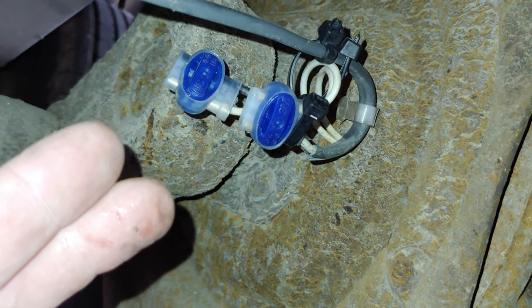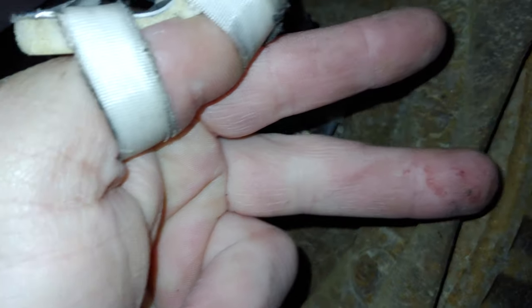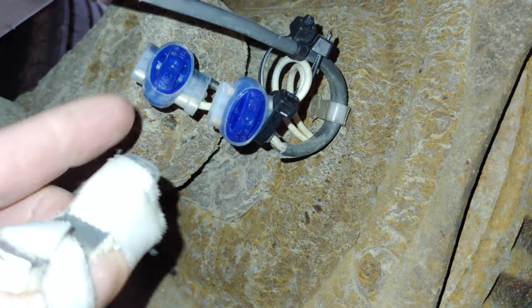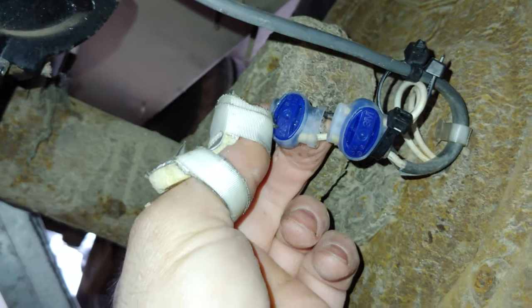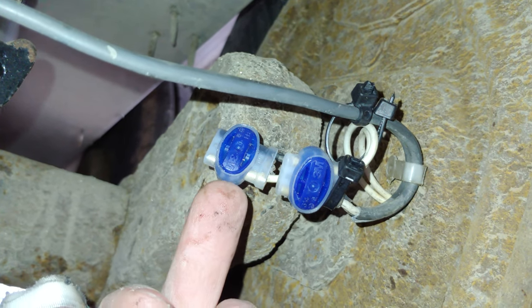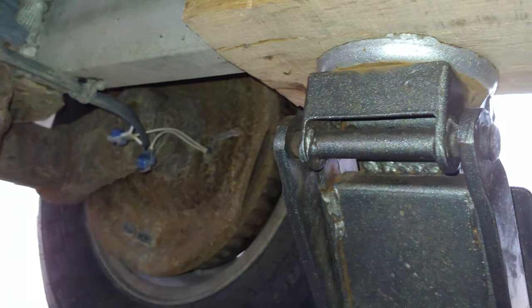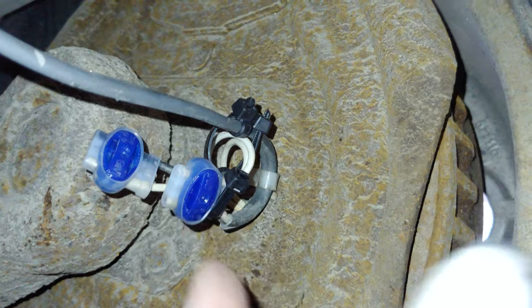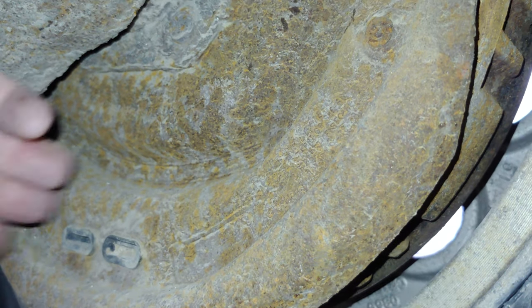It actually cuts through either side of the sheath and makes metal contact. There's a bar that goes all the way across with little tabs that go down over the wire, cut through the sheath, and make contact with the wire. It links all up to three wires and makes contact with all three of them — just butt connects all through them. The cool thing is they're made by 3M, and each one is filled with dielectric grease completely, so when you crimp it down it squeezes out. I did that on both sides since there was one wire disconnected on each. These are only about a dollar a piece, so they're pretty inexpensive — check your local trailer supply or Amazon.